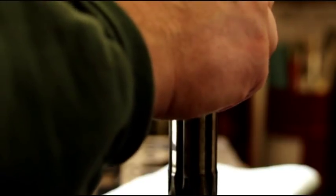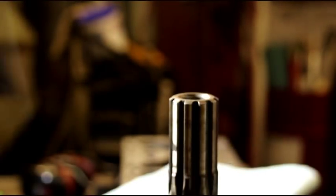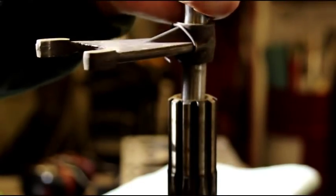Okay, we'll check that. Like I said, you want to be approximately a half inch down. That's 384 — just got to go a little bit more. Okay, so now the bushing is in. We're going to try to put the shaft in there. As you can see, there's no way that's going to fit — that bushing has squeezed down, so it's way too tight. We need to ream that to the right size and still allow some clearance for oil.